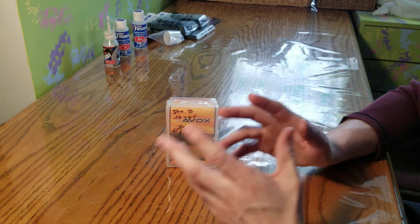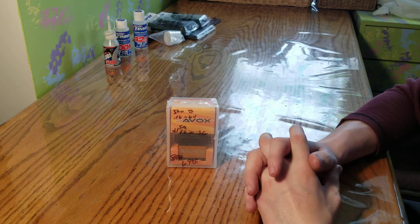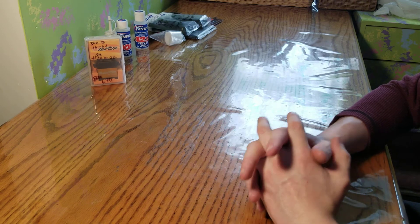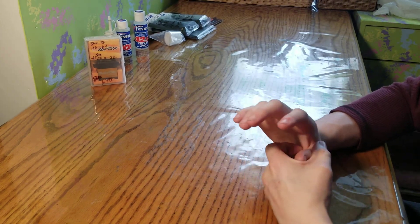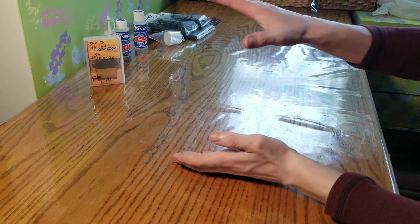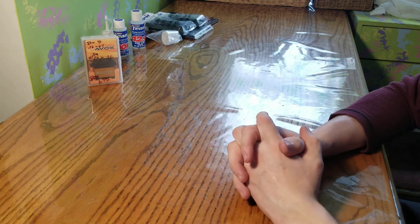On the center differential, I'm not 100% sure if I'm going to use 500k or go with the 20 million — it's not technically locked with 20 million but it can't move as freely as it would with 500k. The truck looks very well built right out of the box — it's my first Arma ever. I think the center diff has about 30,000 weight fluid from the factory, because in videos you can see the front tires balloon like crazy while the rear ones stay normal. I don't like all that power sitting up front — it's not good for your drivetrain.